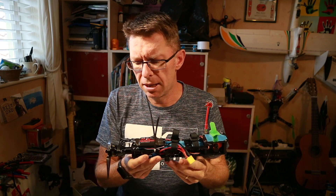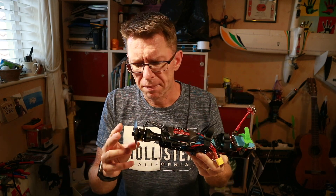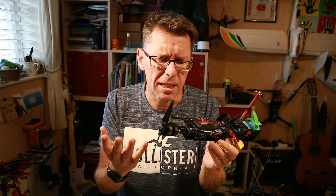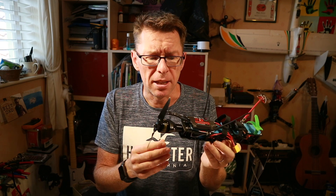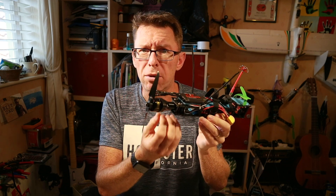Good news was that the prop hadn't just exploded, because these are built for speed so we were a bit weirded out by it. Bad news is that the screws dropped out. I dropped a line to Marcus to explain what happened and ask if I should have been using Loctite, since he didn't mention it in the manual, which is otherwise very thorough. He was pretty surprised as this hadn't happened before. I found I couldn't get the press nuts really tight — I tightened one too much and the press nut had come out, and then we found the real problem.